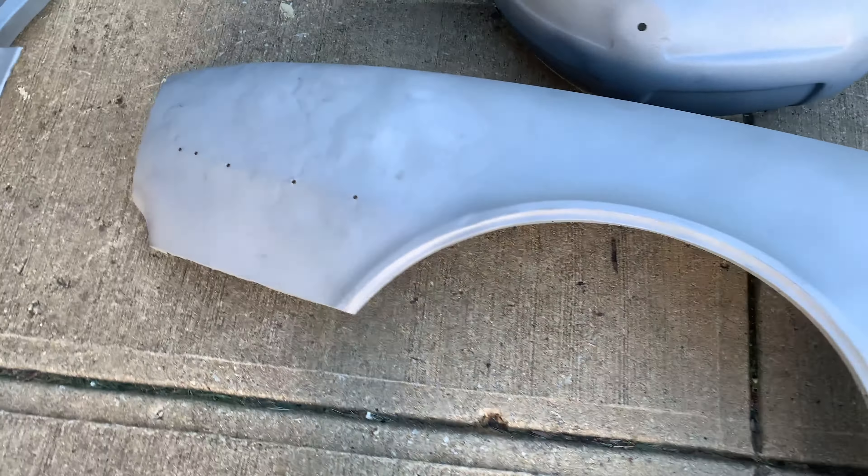The cowling looks nice, definitely not an issue with that. The rear axle — I'll tell you, this is really cool. Rarely can you ever see the stamping of the actual rear end code — the XB — that tells you your gear ratio and stuff. Normally that is so rusted up and gone. This one is actually still really clean; even the part numbers look really nice. So this rear axle is going to paint up really, really nice and I don't foresee any problems out of this.